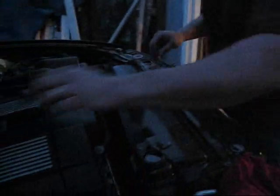No. Alright, so we snugged up that upper bleeder screw. Okay, yeah, this is a better angle. And now we're going to install, and you'll note that the coolant level in the expansion tank is still fairly high. Get out of the way, please. Yeah, okay. And that's good, that's okay, because when the system equalizes and pressurizes, it's going to push out any excess coolant from the tank.